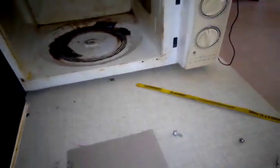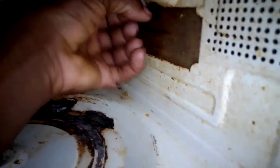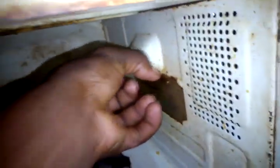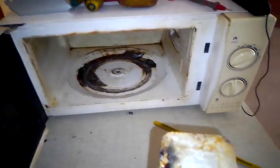This is how you remove the old waveguide — just take it out carefully and don't break it. You can see what's happening behind where it sat. The microwave energy was having a hard time escaping and it's still smoking. This means our magnetron was probably also affected — we may see some smoke residue on the magnetron antenna. I'm going to wipe the area clean before fitting the new waveguide.